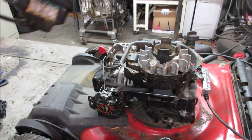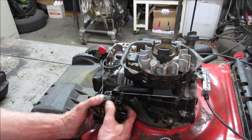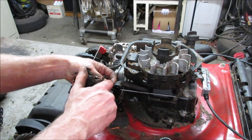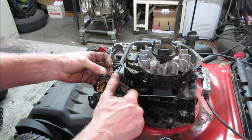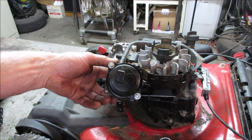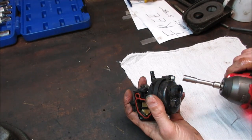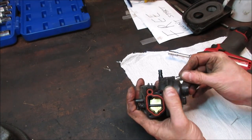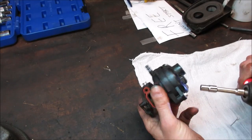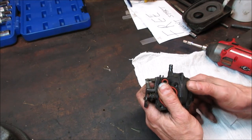Try not to beat it up too much. We should be able to flip it up and get the linkages off. If they had multiple locations I'd mark them, but it just has one for each one. Sometimes you'll see linkages with four or five holes. Let's bring it to the bench and pop that bottom bowl off to see what we've got for crud. It's got a little Allen wrench plug on the bottom. You need the right size socket. Generally if you don't pull the bowl off completely you'll have crud in it. Fortunately plastic doesn't rust, but it does warp.